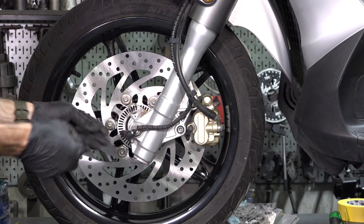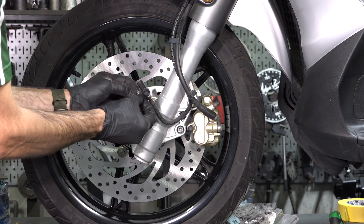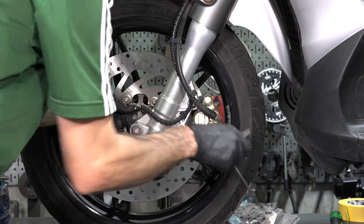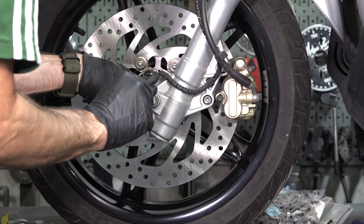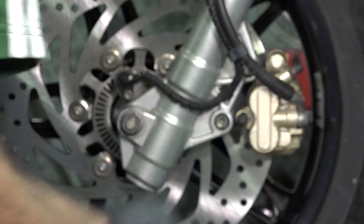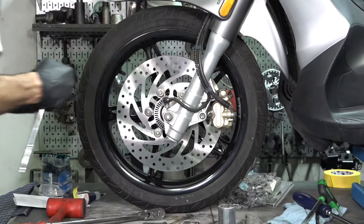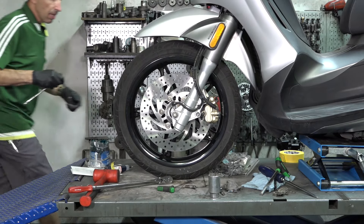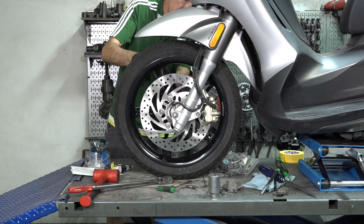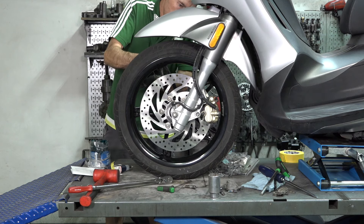We're going to go ahead and put the wheel speed sensor in. Sometimes there is a small shim that goes between the bracket and the sensor. I got a brand new screw because the other screw was a little crusty. There's a little clamp for the tube. And the last step: we're going to get our five millimeter Allen, compress the suspension, and go ahead and clamp the two screws on this side. They're only about seven to seven-and-a-half foot-pounds if you're going to use a torque wrench, and they need to be fairly even since they are a clamp, so go between the two.